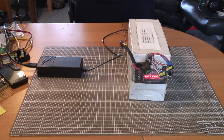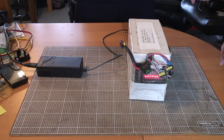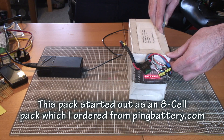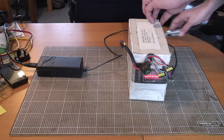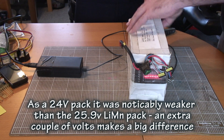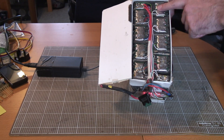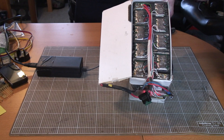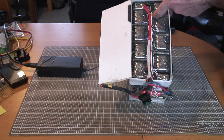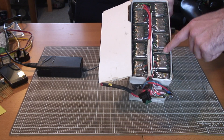Anyway, I'm going to talk about this battery pack for a while — first time it's been opened in five years. I'll cut through the duct tape. There we go. I'm quite pleased with how that looks. What this is, is nine rectangular prismatic cells. Each cell is 20 amp hours. The battery tabs come up between bits of foam, and there's FR4 circuit board at the top with solder pads so the tabs can connect together.